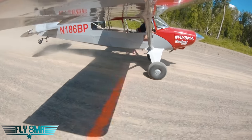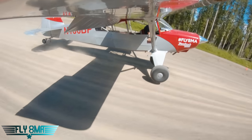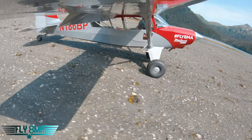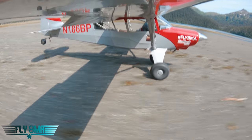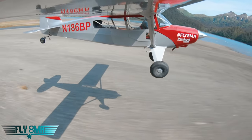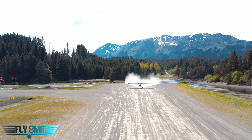Having some weight back there is not a bad thing, so adding a heavier tail wheel to our airplane was a cool thing. It hurt us on the takeoff roll because we don't get the same angle of attack we used to — but is that really that big a deal? The shortest takeoff we ever had was 96 feet at one of those STOL competitions. Now we're seeing that the bigger tail wheel probably added about 25 to 40 feet to our takeoff roll. There's absolutely no way to give a precise number between different density altitudes, different gusts of wind, different days — it's not a perfect science.